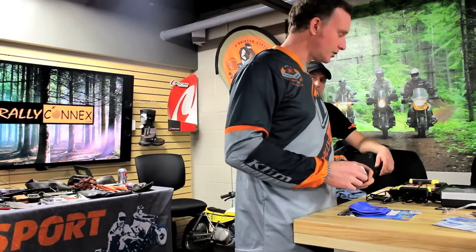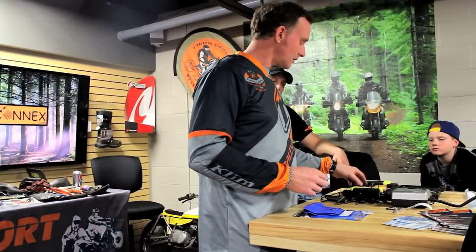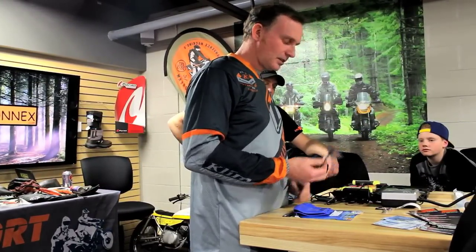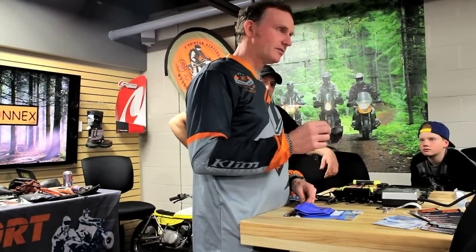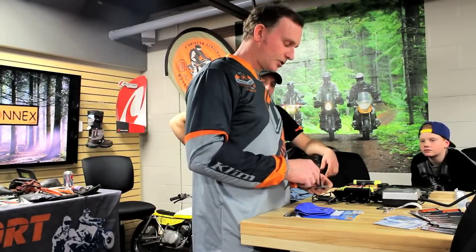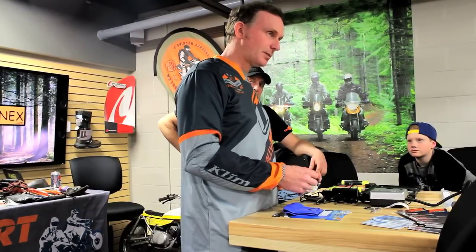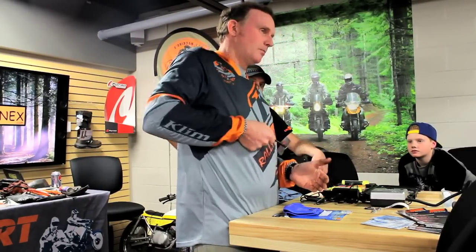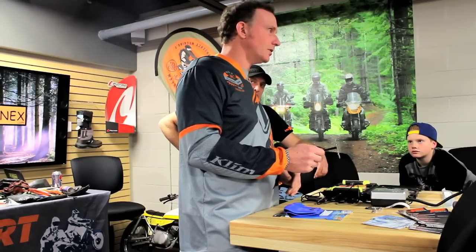If you are riding a tubeless tire and you get a huge hole, something you figure you can't fix with these little pieces of licorice, then you'll have to pull the tire right off and patch it from the inside. Right? So you take the foil off, lubricate this up with rubber cement, push through, pull it, press it down. That'll cover a huge wound in your tire.